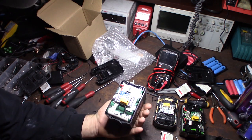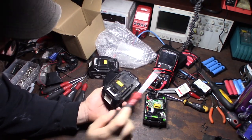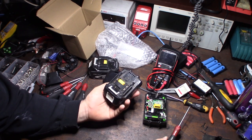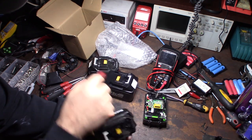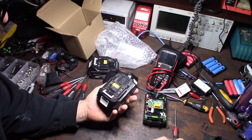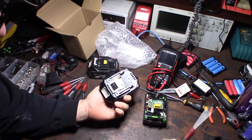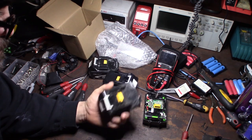One of the problems with genuine batteries is the circuit protection can fail at the worst possible time - I've actually had them fail on a job when I really needed my screw gun. I actually kind of like these bootleg batteries because they don't fail abruptly; you'll notice it getting weaker before it dies. That said, if cells get too deeply discharged - like from sitting around for years - the board's parasitic draw monitoring the cells can eventually kill the pack too.